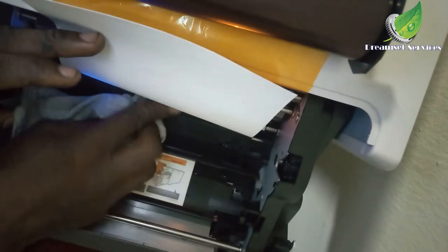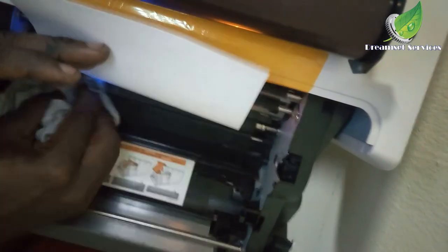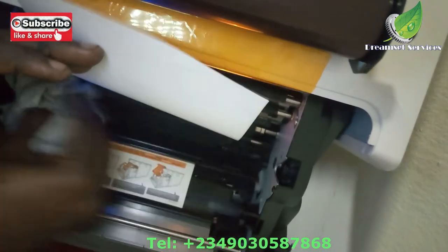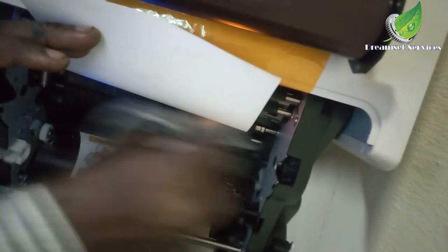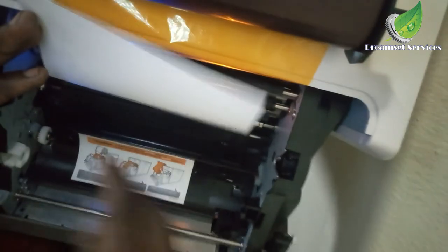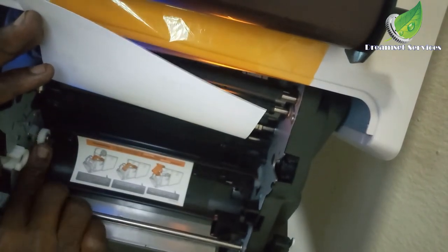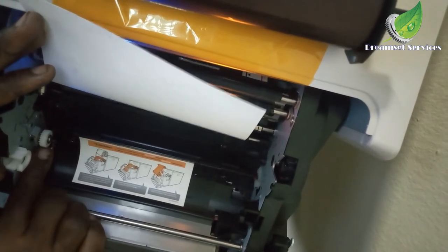When the paper stalls inside and you power on the printer, it will fail to initialize. The problem with this particular machine is that it doesn't initialize at all. Immediately you put it on, you're supposed to hear the machine initialize — all the gears in the machine are going to spin, and then it will test all the movable gears to be sure they all move and check if the paper is inside and fitted properly. If that doesn't happen when you start the machine, it will ask you to power on and off because one of the gears is having an issue.